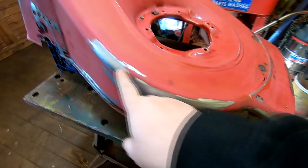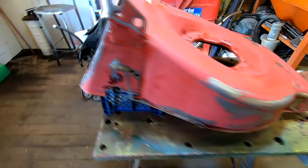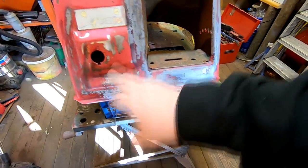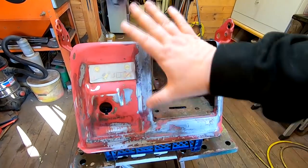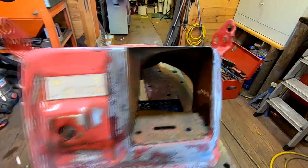And there's some bare patches, obviously, the metal where it's gone back to the metal. Don't forget we treated all this with the Vactan treatment as well. Where it's gone discoloured, that's the Vactan, which has converted the rust. I'm not worried about this. We're going to paint straight over all this. But first of all, we're going to need to prime it first.